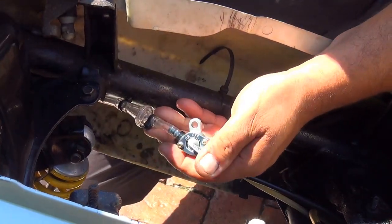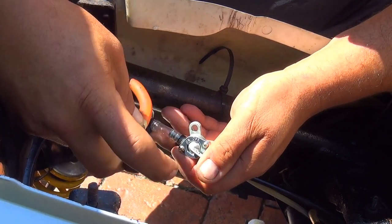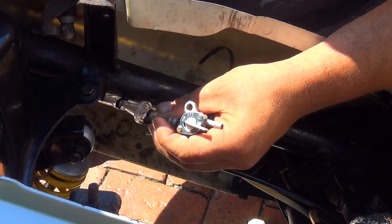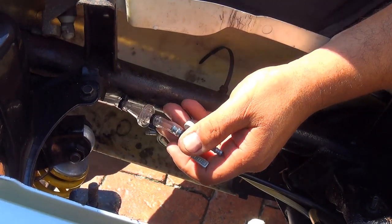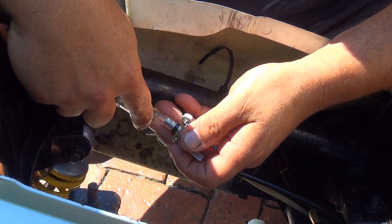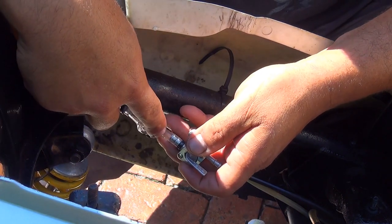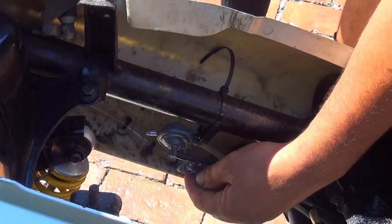The seat looks perfect now. With this clear hose you can see if something is happening on the line — very important. If you have a dark or black hose you won't be able to see if the fuel is flowing or if it's dirty. With a clear hose you have an idea of what's happening without opening anything up.